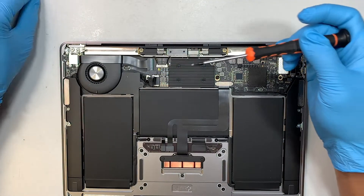Once the Wi-Fi antenna is in the right position, press it a little bit in the center so the clip goes back in. At the same time, align the LCD board so the two black screws can go back in. Get the T4 screwdriver and put the two screws back in to lock it down so it doesn't move around.